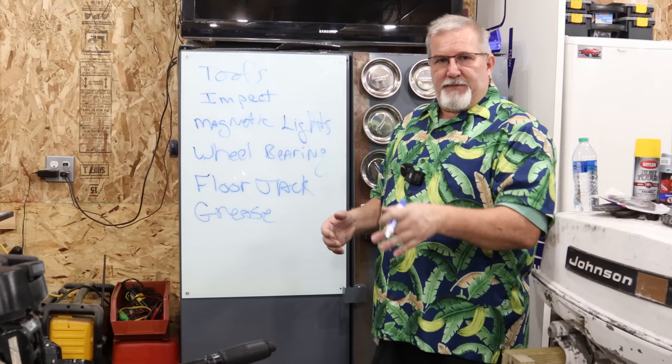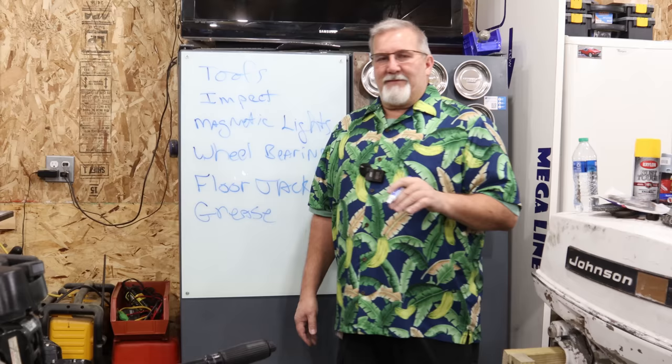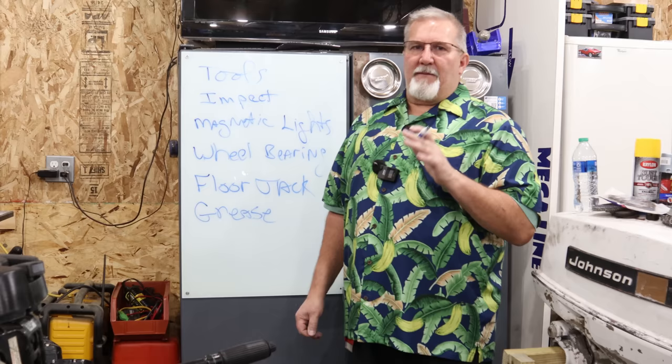If you pick that wheel up and you hear this growling sound, and I ain't kidding you, 9 out of 10 times, that's 90% to you and me, 90% of the time, you're going to hear that growling sound because those wheel bearings were neglected. By the time somebody decided to get rid of a boat, they probably stopped caring for a boat a long time ago. Much like a divorce.